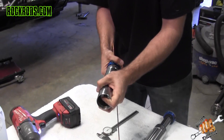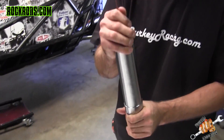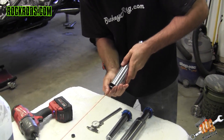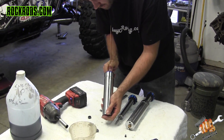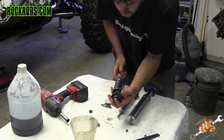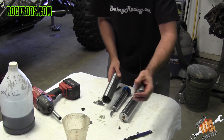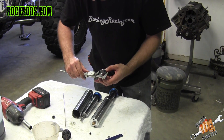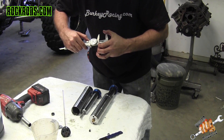Pull everything down to the bottom. There's the shaft, there's one shim stack — you can see it all together. Reach back down in here and push the rest of it out using the rod, keeping everything aligned. This is what we're going to be modifying — it's just a piece of steel cut to the right size, one and a half inch outside diameter, looks like 120-wall.